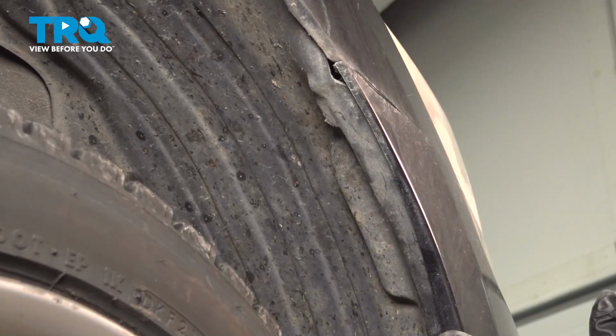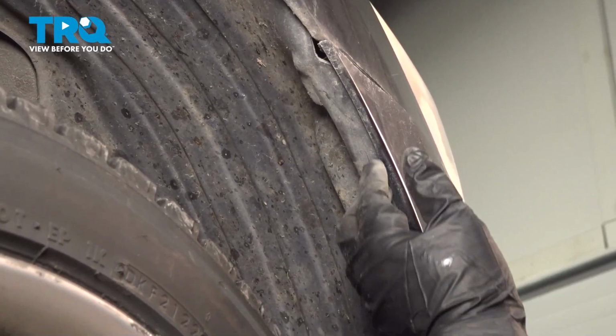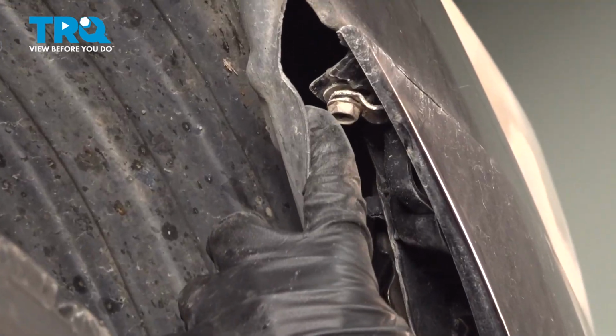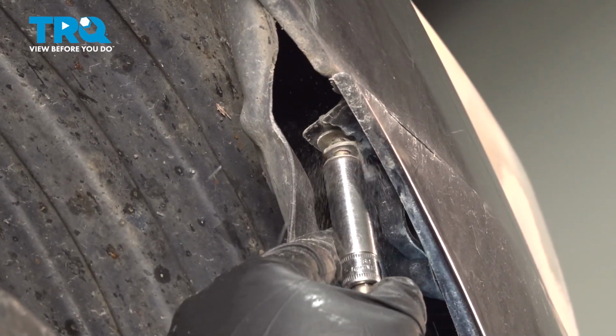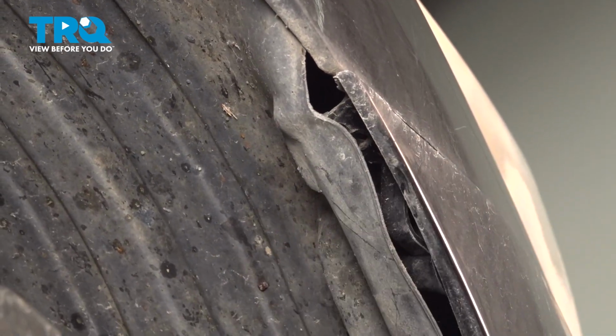From inside each front fender well, you're going to follow that bumper cover up, and here's the inside liner, the flare liner. You're going to pull that and get that a little bit out of the way, and you'll see a mounting screw right here, 10mm socket. You're going to do the exact same one on the other side.